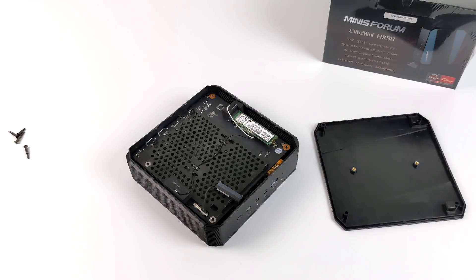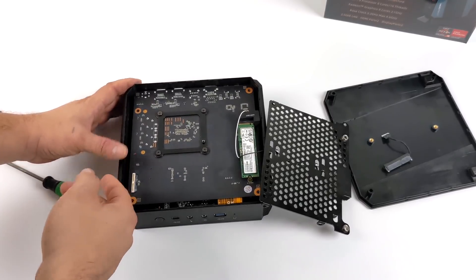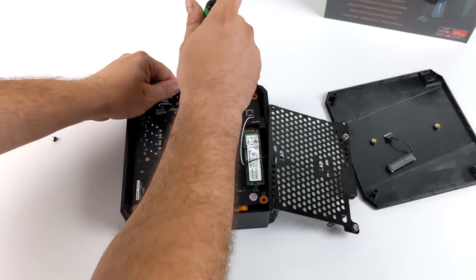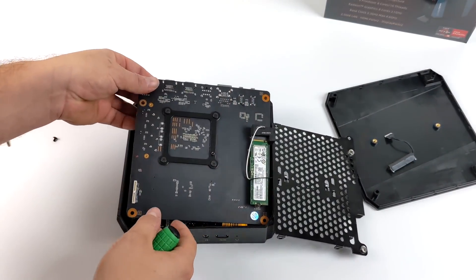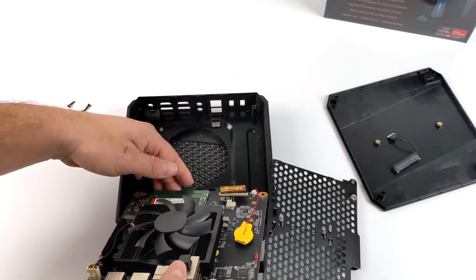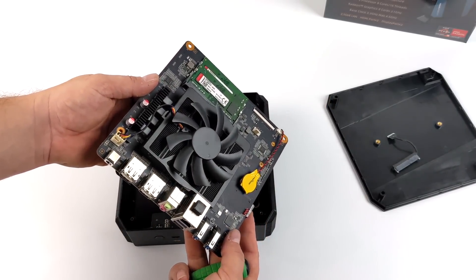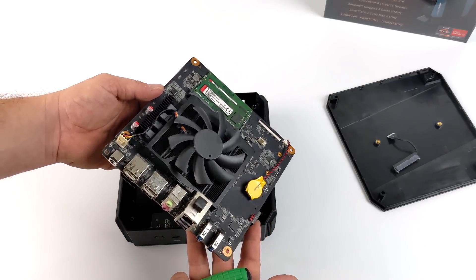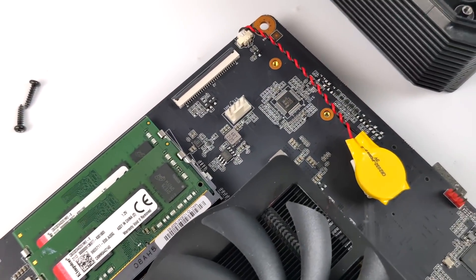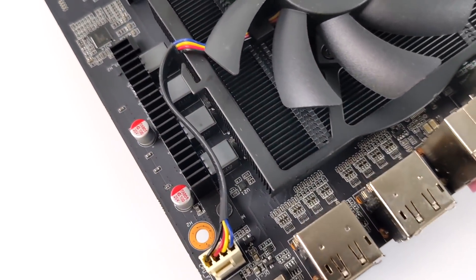You do have to lift one side up and pull the other side back to get all the ports out of the case itself, but it can be done. Put a little pressure over on the backside just to get the ports out, make sure the USB and everything clears, and we can lift the main board out. There is kind of a front daughter board connected using a ribbon cable. Now that we have the main board out, going back to the footage from my original review, I didn't notice any liquid metal anywhere on this thing. When Gamers Nexus pulled his apart, there was liquid metal on the cooler — it looked like it splashed up through the fan and the fan threw it around the interior of the case. This one here is super clean.